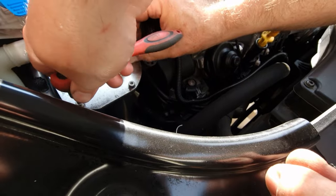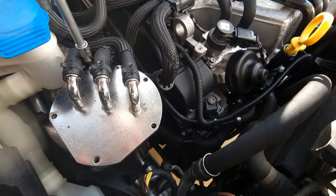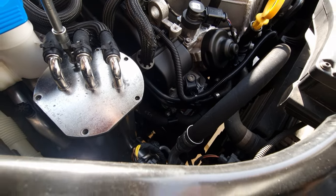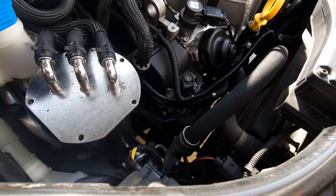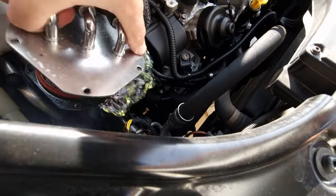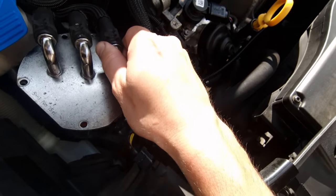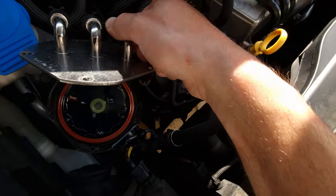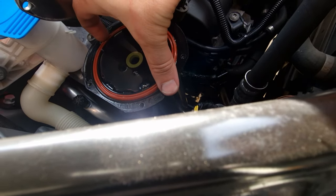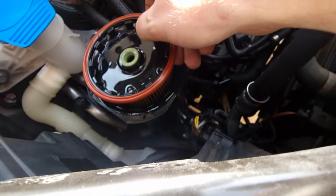I'll get this one out because I need the longer one. It won't fall because it's magnetic. That's M5 - yes. Now normally this is like a mess - it's got a special gasket seal. I knew it would be a mess - it always is. Now we've got to drain out a bit of this fuel. Only when we put a new filter - when I take this one out it will be okay, but when I put the new one back in, we'll have to drain it or else it will overfill because it takes time for the filter to suck in the fuel.